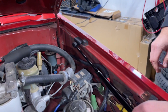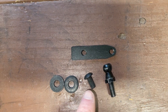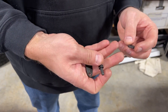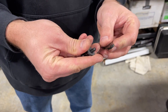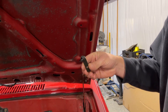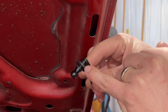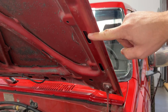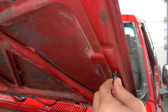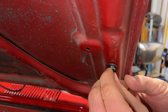For the next step you'll need one of the nut plates, one of the ball studs, one of the shorter M6 bolts, and two washers. Start by putting the ball stud through one of the washers and partially threading it into the tapered end of the nut plate. Leave some gap so you can capture the hood between the washer and the nut plate. Use the second hole up — slip the nut plate inside, raise it upward, and thread it in so it captures and clamps the nut plate against the hood.